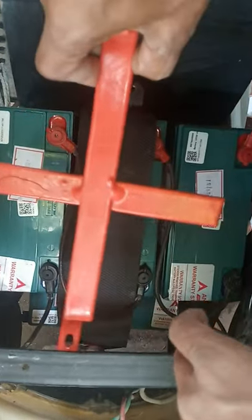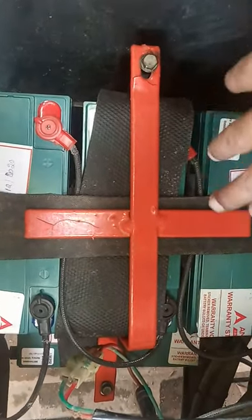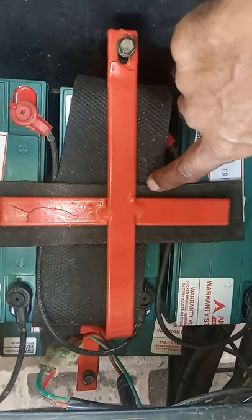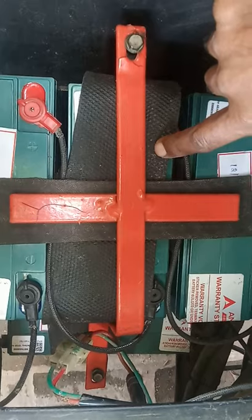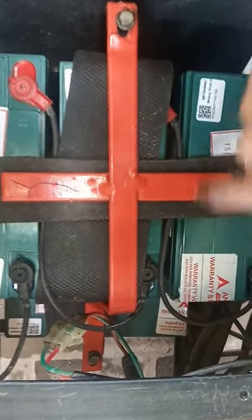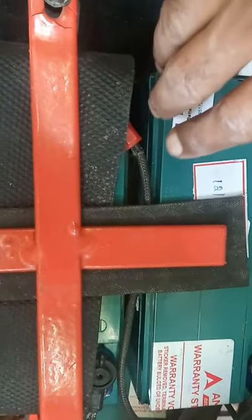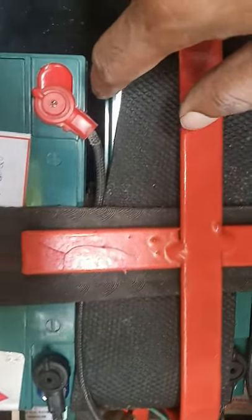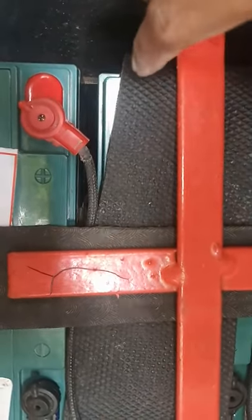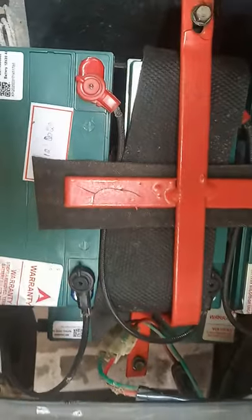Be careful to note which insulators have been placed. Place the pads — there are pads in between the batteries too, which is very important. It is important to keep a pad between the batteries as well. We have kept a pad between batteries and between the battery groups. The batteries need space because they heat up when charging, so there has to be space for air to breathe.